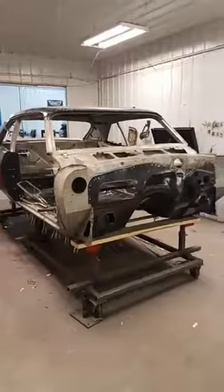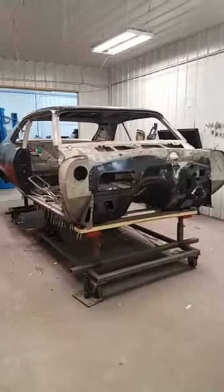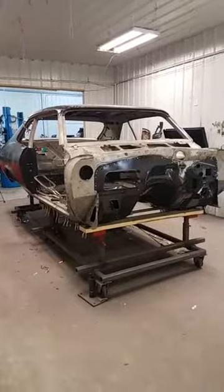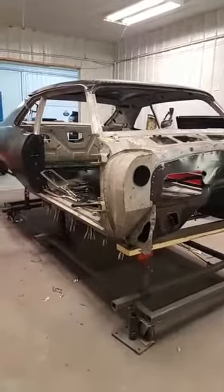Steve has been working very diligently on getting the fourth quarter Nova in its test fitting stage, and I'm going to show you some of the work we've already done on that car and how we've got our metal room set up so that we can work efficiently in fabricating panels and doing sheet metal work. A bunch of new tools just got added in here. We've still got a couple on the way, but we're buying them one at a time because we're running out of room. So I'm going to flip you around and you guys can take a look at the fourth quarter Nova, which is sitting on a body cart. We took it off the rotisserie because the rotisserie was allowing for too much flexion in the body openings, so we wanted to make sure it was totally level, straight, and that we had a square and secured surface to work with. So far we have removed about 90% of the metal from the main body that we are going to be taking off.